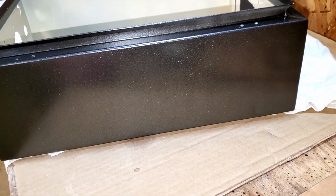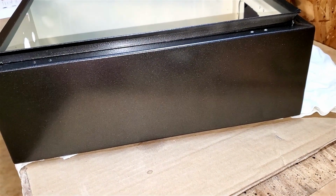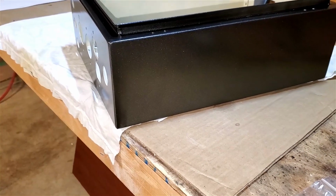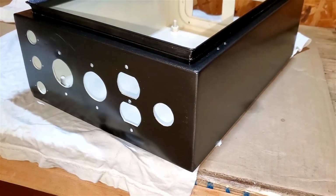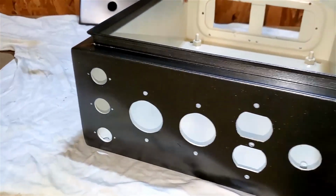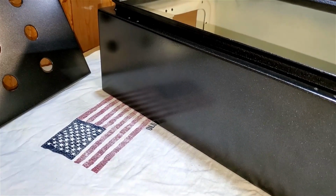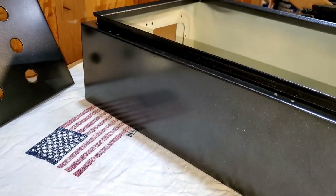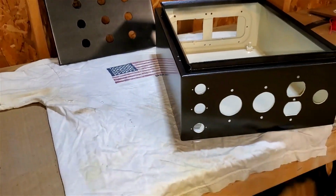On the sides here, I did find that you gotta sand that clear stuff down and get rid of that orange peel, because in a couple spots that I didn't bring it literally all the way down, you can still see through it. But on the big long pieces here, this is incredibly smooth, and the paint laid really well too. So it's probably enough of the panel.